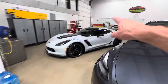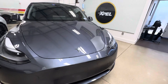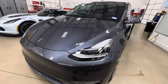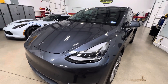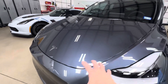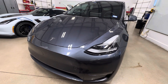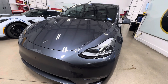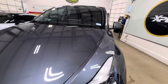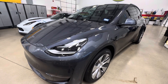First, every car that comes in — whether it's a Porsche or a Mercedes — they all get full decontamination of the paint from all the stuff in our environment: transit, factories, whatever. Then a polish because we want to get the best surface possible before we seal it in with the polyurethane. The Xpel products are the thickest — 8 mil, fastest self-healing, 10-year guarantee. Our installation guarantee is as long as you are the owner of the car, and that all comes in writing. The tint is transferable and lifetime.